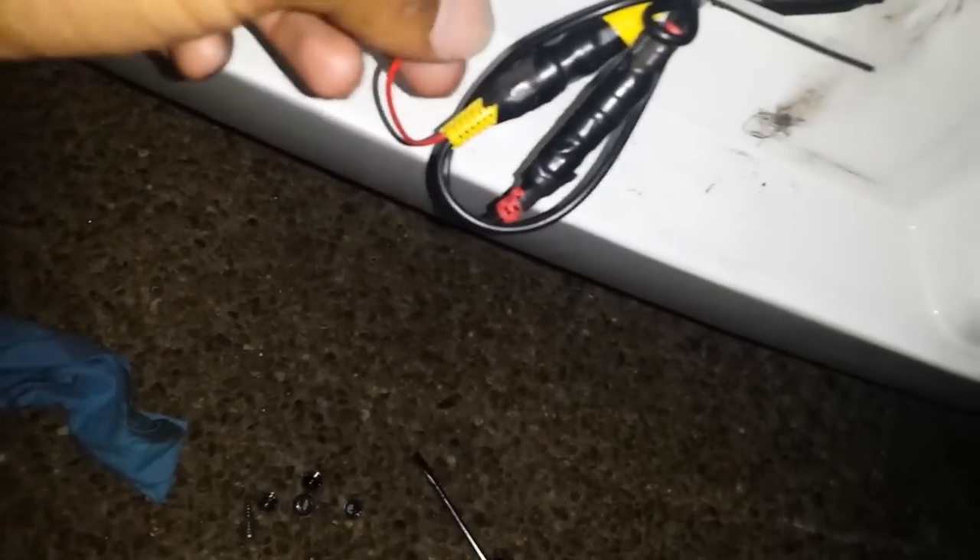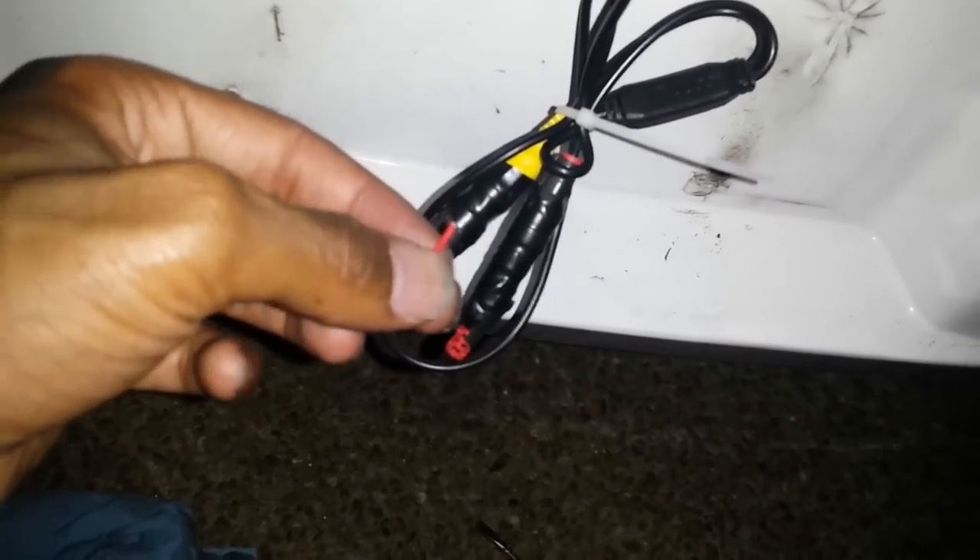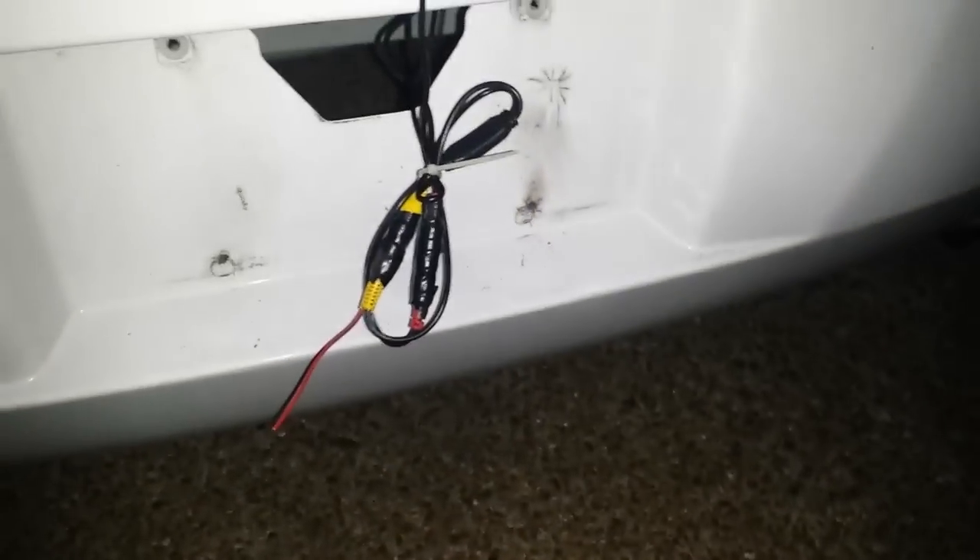After the first test run, the camera didn't come on. The lights on the camera came on, but the video input didn't come on. So this red wire that's on the actual RCA that goes into the radio — I'm going to hook this up with the wires that came out of the camera and hook it up to the reverse light, and then once that kicks on, everything else should kick on and be good to go. That's the plan.